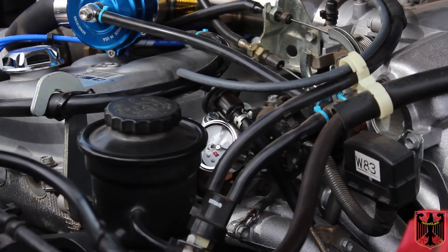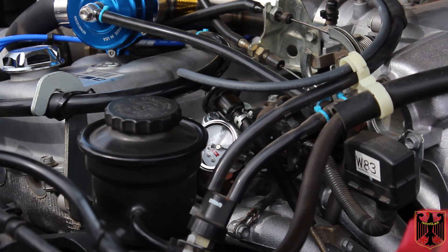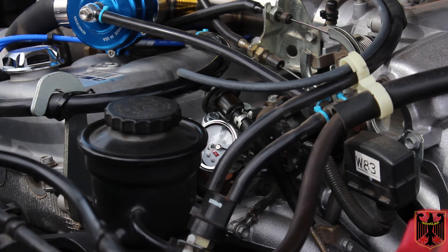We put this fuel gauge on to try to troubleshoot an issue with rough engine idle — we were concerned the problem might be a fuel pump or a fuel pressure regulator. At this point we're pretty much sure it wasn't either one of those, because the spec for fuel pressure at no vacuum is 38 to 44 psi and right now it's at 44 psi, so we think that's good. When it's running it does go slightly higher, but this is a turbo system so it's demanding a bit more fuel.